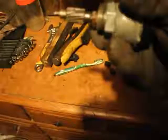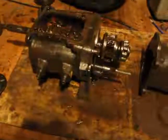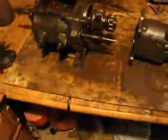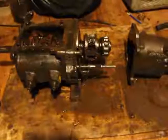When you're trying to remove a bolt or anything with a thread, you won't force it in only one direction. You just work your way around like this, back and forth, and of course spray some of the diesel oil mixture. If this was WD-40, I'd be broke already. Diesel works great, by the way. If you want to use expensive stuff, that's your call, but in my experience diesel works great. My great-grandfather used to use it back in his garage, so it worked for years. It's still pretty good now.